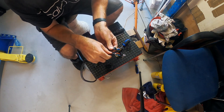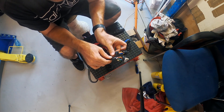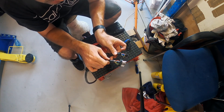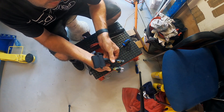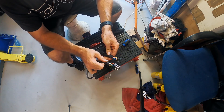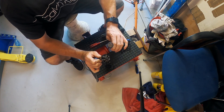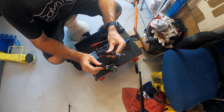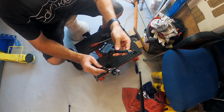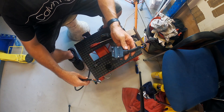Hopefully you can see it there. On the top we've got blue and red, although this one does have a white stripe. Then to the left of those we have yellow and green. If we flip them right over we've got black, white, and green. So it appears that the wiring is actually in the same configuration and the same colors, which means we might be lucky here. I'll take this end off and I might be able to just unpin this one and pin it straight into the flat pin.